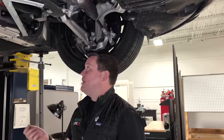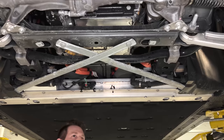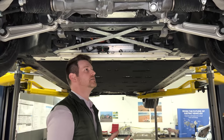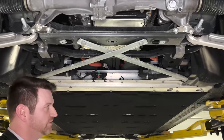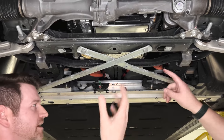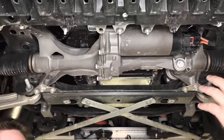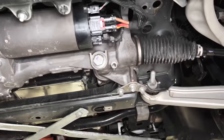Back to the theme of the right material for the right task — many German OEMs like BMW and Mercedes use X-braces underneath the cradle. This is a relatively small one compared to what we've seen on BMWs. These are known for their ride and drive and overall driving dynamics, and this X-brace helps tie load paths together cross-car with the cradle and move things outward to tighten up the vehicle. They also tie in the front steering rack as a structural element — it's bolted directly into the cradle. These braces look like they're there for tension loads in either direction across the X, and the rack is also very serviceable in this position.